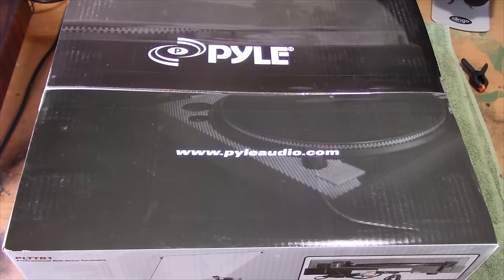This particular one is a non-USB version. That one costs about $25-$30 more than this one. So there is no phono preamp built into this — it's all just direct line out to the stereo receiver from the cartridge, which is the way I prefer them to be. The reviews I've seen of these turntables with a built-in phono preamp — the phono preamp is typically not regarded as something worthwhile. People usually pull those out and rewire them so it just has a direct shot from the cartridge out to the tuner.